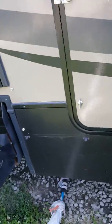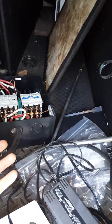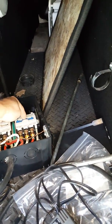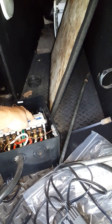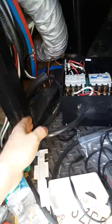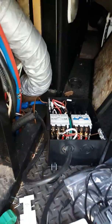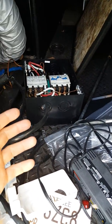The next problem is diagnosing why you don't have power inside the camper. I had to take this out so I can actually get to it — usually they're difficult to access because it was underneath all that stuff back there. This is a power transfer switch. They're magnetized — this is obviously hot so I'm not going to touch it — but when the electrical current hits it, it magnetizes, drops, completes the circuit, and allows the electricity to come up into the camper.